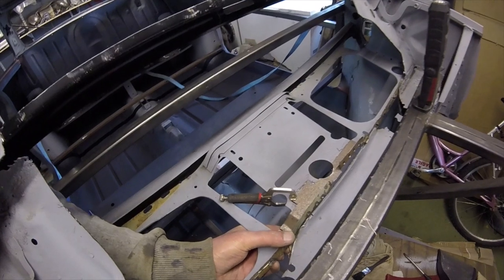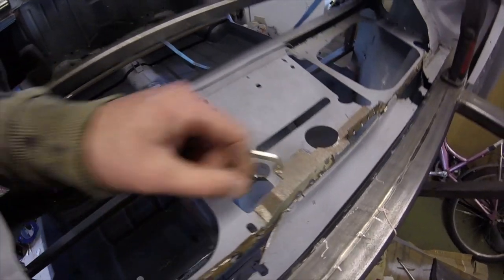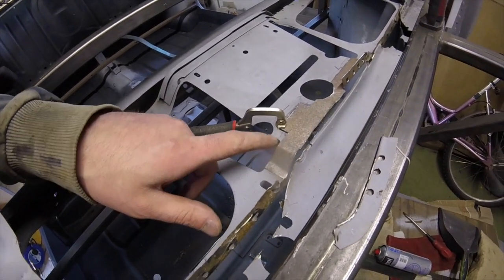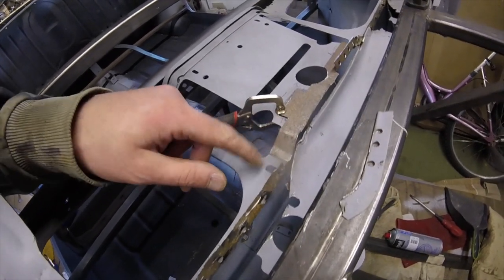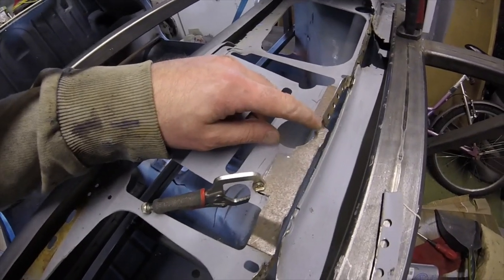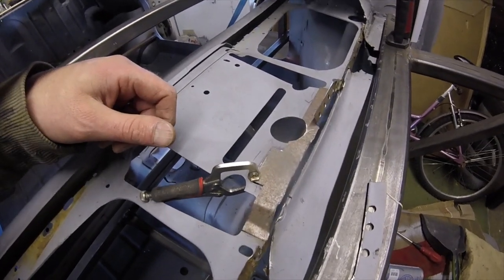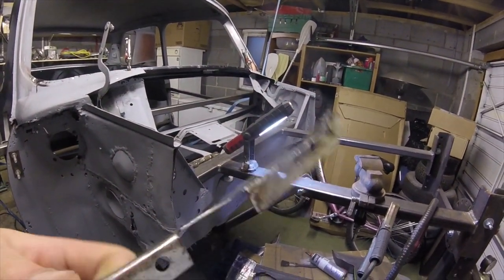There's the next update — I'm just holding that piece there, but it'll need to get welded on to the back of the new piece. Here I've just used a couple of pairs of pliers to push it pretty much straight for one bend, and then a very slight angle bend to make that form match the line I drew before I flattened the piece. I drilled some holes for plug welding, although I'm not entirely sure whether I'll be able to make those plug welds. But hopefully we will — right, we've now got that piece welded on.